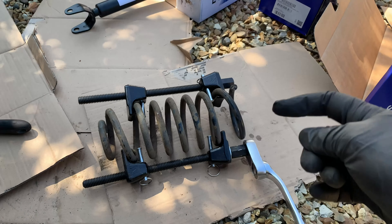I've got to put these back on and do them up slowly. But the more I look at this, the more I think the problem is the actual bush in the car, not the shocks. These are looking a bit worse for wear and have probably done about 70,000 miles, so swapping them over is worth doing. Next thing: tighten that up, get that on, use the new nut, then try and get it back on the car.